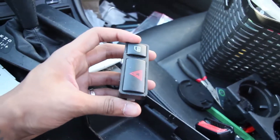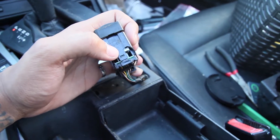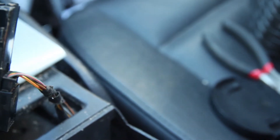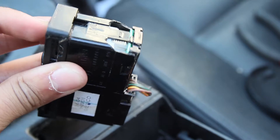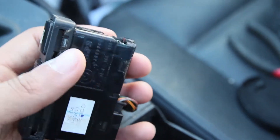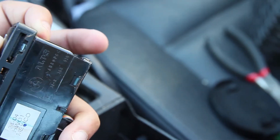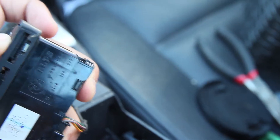The main issue with this here is that essentially, over time, as you can see, mine's already cracked, actually — the housing for it. Over time, the housing for it here actually just cracked. And what happens is when you push this — I don't know if you guys can see it — but when you push it, the whole housing is actually moving. The housing base itself actually shifts with it. So the simple solution right now is you're going to take either super glue or tape. You want to be able to push this back in and hold it up. When I do hold that in and press the button, the locks work, as you can hear them. But when I'm not holding it in, the whole base moves — it's not making contact.